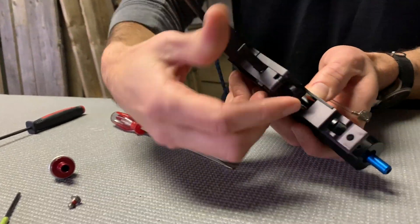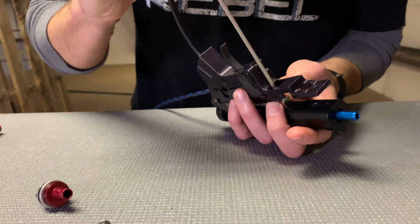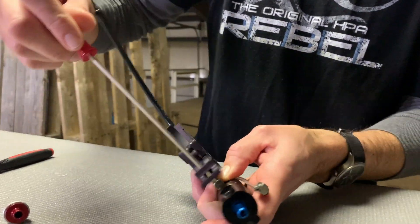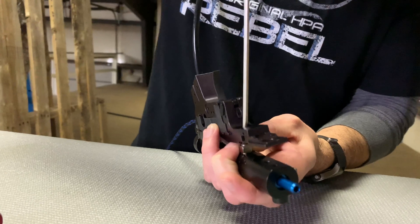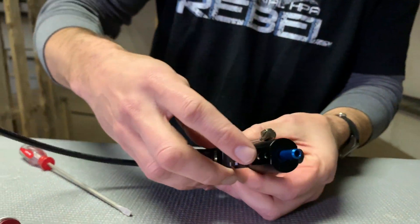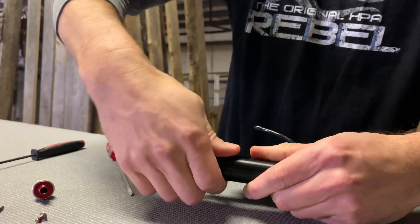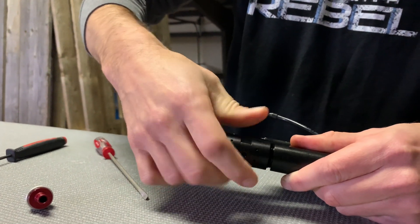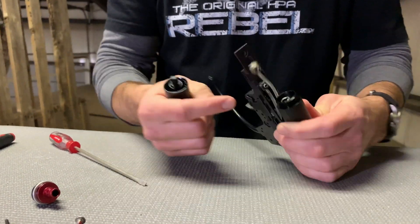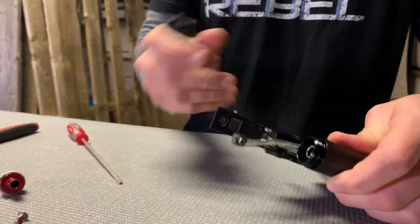Alright, so that's the front one. Take the rear one out through this hole here. You can actually pinch the line through the sides of your fingers to hold them in place and loosen it. Now that that's separated, we can unscrew the front and center cylinders from the rear. Inside there's going to be the spring, so if it comes out just pop it back in. There's a little boss in there it fits on top of and that's what keeps it centered.